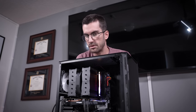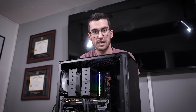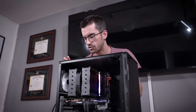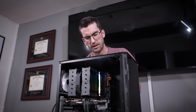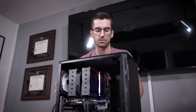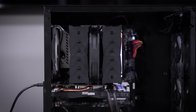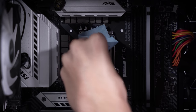I don't know — could be a CPU issue still. Maybe we have some bent pins, something lodged between the pins in the socket and the pads on the chip. I kind of want to dig in there next. I don't think this is a wiring issue — it's just too specific of a problem. But I'm still going to do my due diligence off camera and check those things. What I really want to do is get this cooler off because I think something's going on with the CPU. Definitely 10th gen because this is a B460 motherboard.